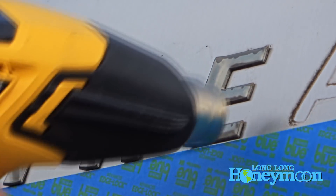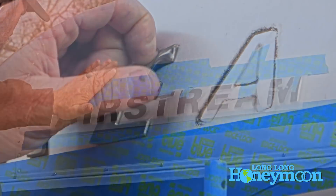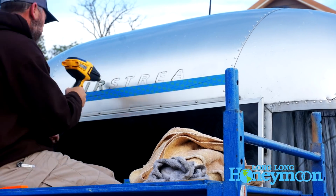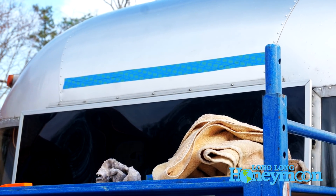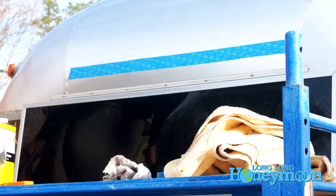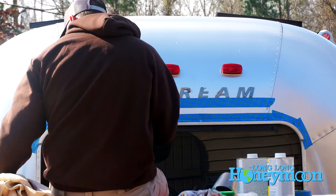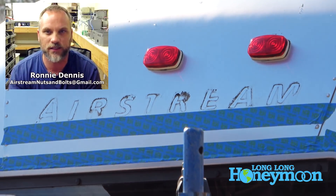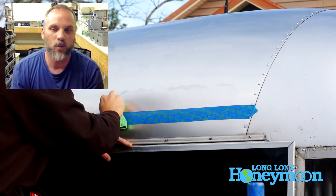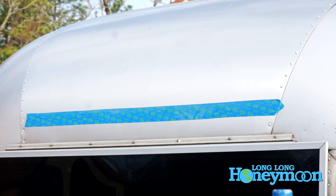They changed the logo styling a little bit over the years. Our 2003 trailer logo is a slightly different style than what is current on Airstream travel trailers, so we went with the new 2020 style. We put painters tape as a straight line underneath the existing Airstream stickers before removing them, so we had a flat plane to work off of. Then we removed the old lettering, cleaned the area, and used rubbing compound to remove some of the shadowing or ghosting in the clear coat from years of sun exposure. After buffing, we used denatured alcohol again to remove the wax residue from the surface.